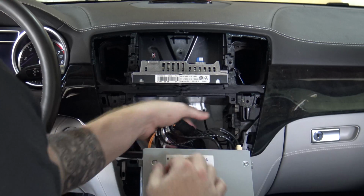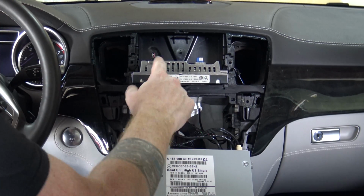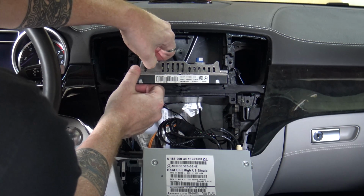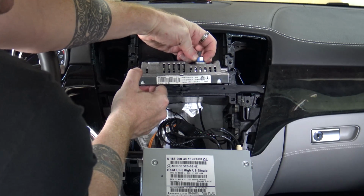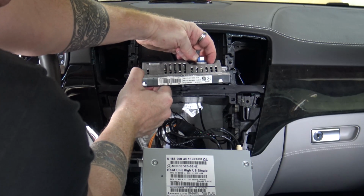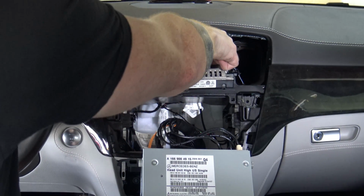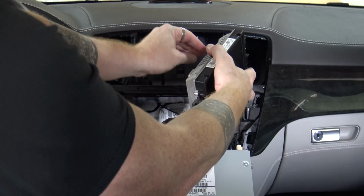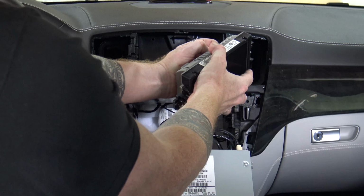And these are actually cables that are coming up off of your head unit right here. But you've only got 2 cables here on the back, and they're little squeeze connectors. So you want to squeeze on them and take it out. Same thing here. Take the blue one out, which is a little bit tighter than the other. It looks very similar actually to the optical cable you see on the displays on BMWs. So there's a little tab on it, and it is really tight.